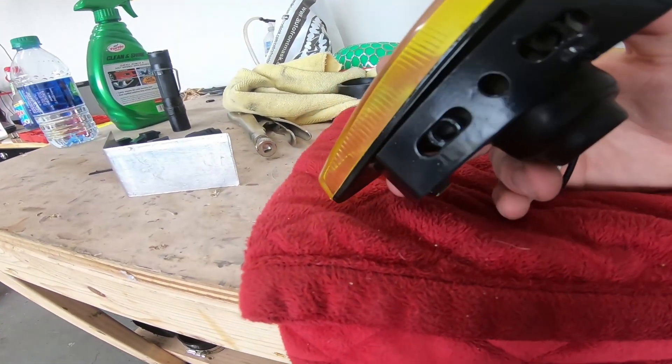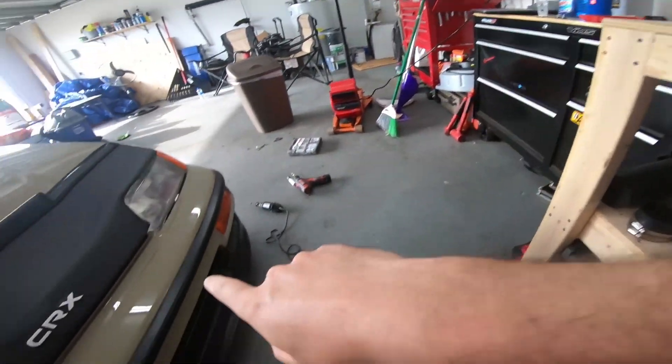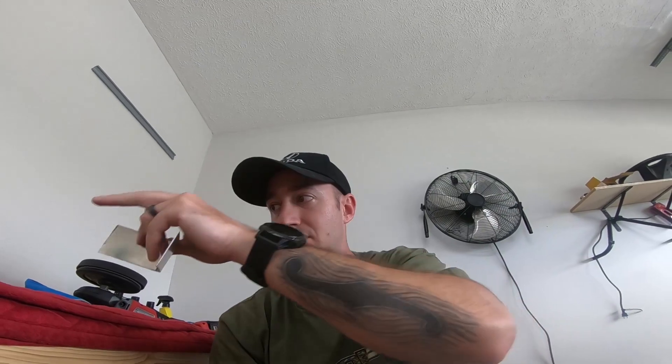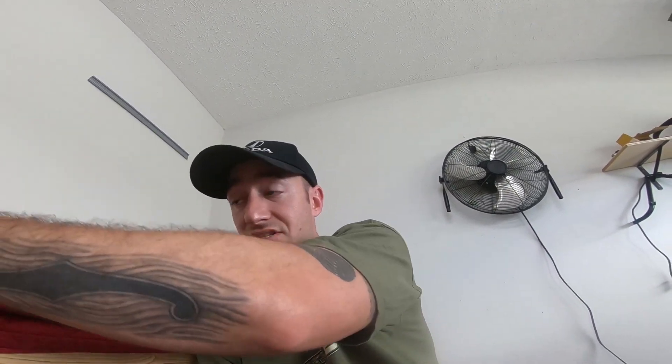On the side here I haven't finished it yet, but I'm gonna take this piece of aluminum and make it match a rough pattern so I can bolt it to the backside. This is going to attach here like so, and this is going to pull to the car body. Now when you're looking at your bumper — some people back in the day, and you can still find it in the forums — essentially just took this bracket, folded it up on top or on the bottom of the light, and then drilled through the bumper itself underneath to secure it. You can do that, but what I'm doing is probably gonna be the easiest method.